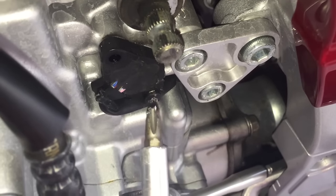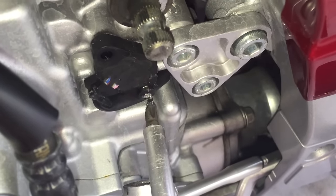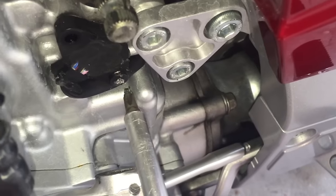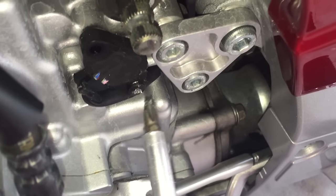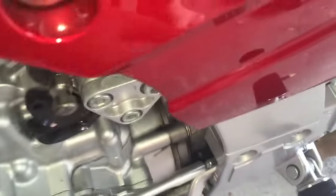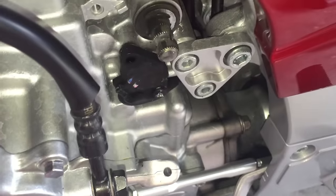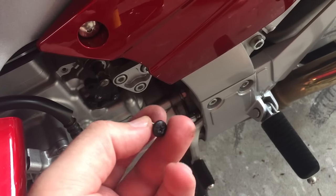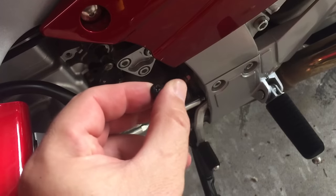This is such a piece of crap screw — it's just coming apart. I'm gonna get that off with the pliers and obviously order a couple new screws. Bear in mind they are super soft and ridiculously tight — they didn't even start to loosen up until almost completely off the threads. They're almost completely covered in thread locker. That's not how you do it — way too much from the factory. My better thought: I'm not gonna order new screws, I'm just gonna go down to the hardware store and replace these with Allen head or hex head screws. Much better idea — there's nothing special about the thread or the screws themselves except that they're Phillips.